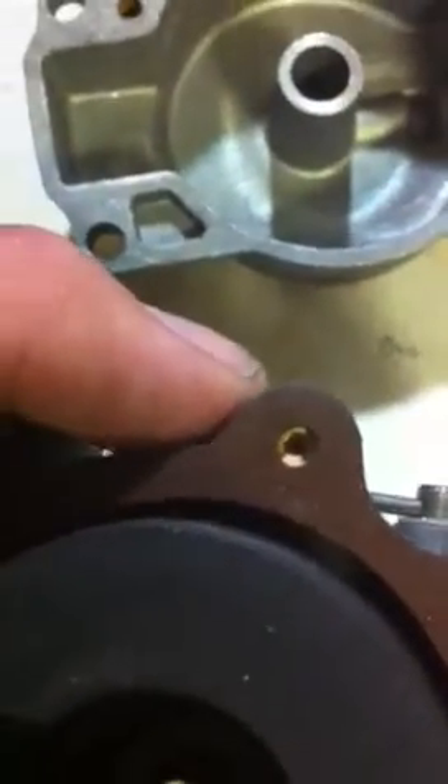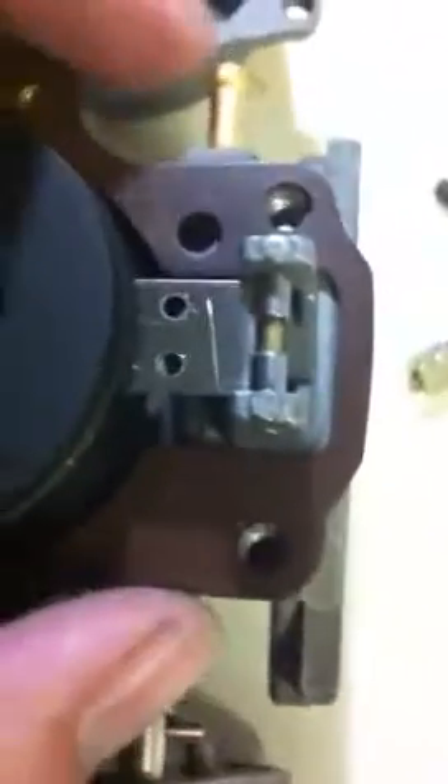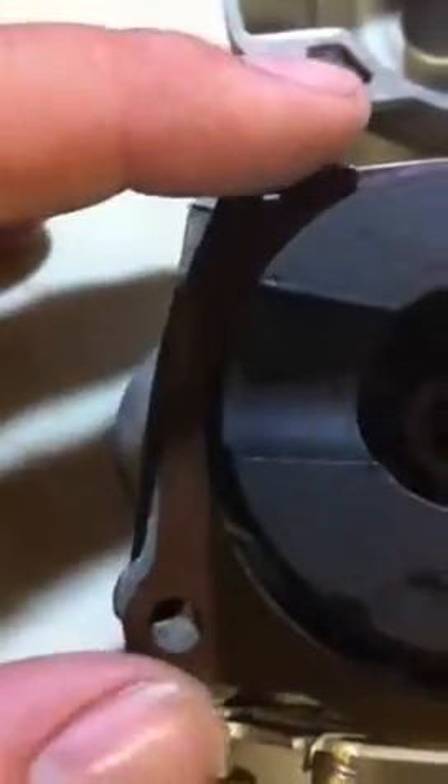This is the bowl of your carburetor going on the middle carburetor. You can tell it's the middle carburetor because it has this right here, which is your fuel inlet. This is your gasket — it goes like this. This hole right here cannot be covered up because gas flows through that hole, so put your gasket on just like this.